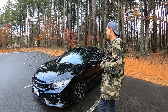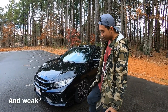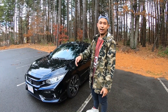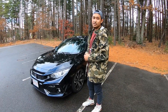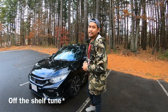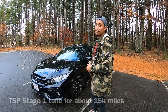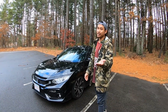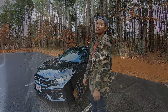The fifth and final thing I hate is the clutch. The clutch pedal feels so light — it's not even three pounds of pressure putting your foot into it. For someone daily driving this car it'll be good, it's a great daily driver, easy around town, no foot workout. But if you're a car enthusiast who will eventually add bolt-ons and more power, it will begin to slip and you'll probably need a stronger clutch. I've been tuned on K-Tuner TSP stage one running map three in sport mode, and I haven't had any clutch slippage thankfully. It just depends on your driving habits — if you always slip the car, race it, or lug it, that will decrease your clutch life.